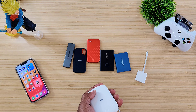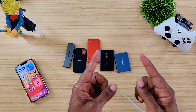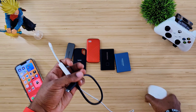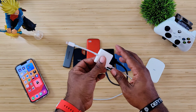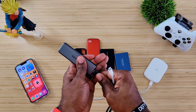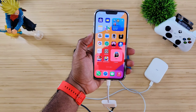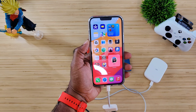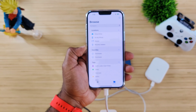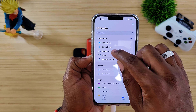I'm going to plug up to this battery, power it on, plug one end into the Camera Kit, and then use a USB-C to USB-A cable. I want you to be able to see everything — I don't want anyone saying I did something off camera or used another cable. We do have power from this device. The first one we're going to test is the RAV Power — that should work. We're plugging it up and waiting for the charge indicator up top. There we go. Now that we have the charge indicator, we'll open up the Files menu and wait to see what happens. RAV Power is open.